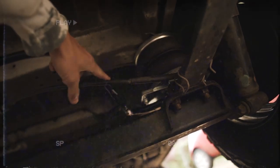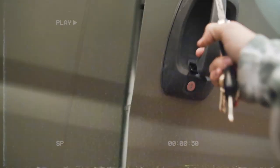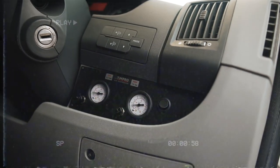I've tied up all the rear and put stainless steel P-clips on the conduit just holding the airlines in place. I've also wrapped it in cable tidy stuff and electrical tape so no stones can bounce and split the air hose whilst I'm driving. It's just passed the MOT — the tester was happy with how it was secured. Apparently if you cable tie it, that's a fail because it can interfere with the suspension system. And that's what the install looks like — super clean, really happy with it. That's the Timbro air suspension on the Fiat Ducato.